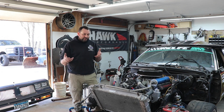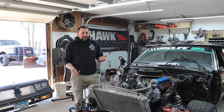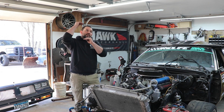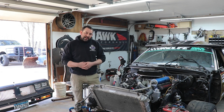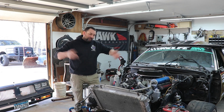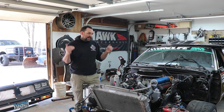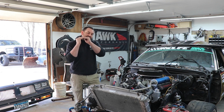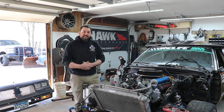So there's kind of this balance. But if you're worried about it and you want to build that air dam and make some block-off plates — paint them all black, hide them behind the grill — unless somebody decides to stare through the grill, nobody's going to notice them. And it gives you a lot more headroom on your cooling system. If all of a sudden your engine goes a little out of tune because something went bad on your carb or your distributor, or a spark plug fouled out and now you've got a cylinder running bad, you have that headroom. If you're sitting in traffic or cruising on a 100-degree day, if you're right at maximum capacity to manage your car on a 75-degree day, when it's hotter you're getting less temperature drop because the air passing through the radiator is hotter — you'll be a whole lot safer having that extra headroom.